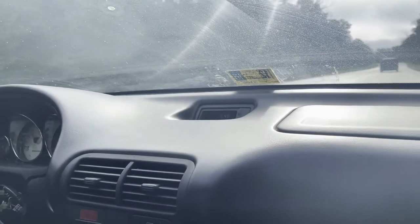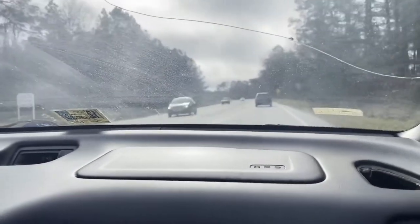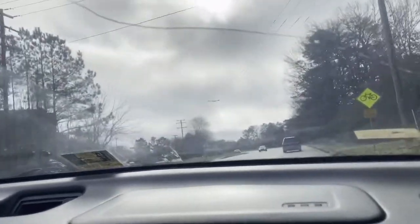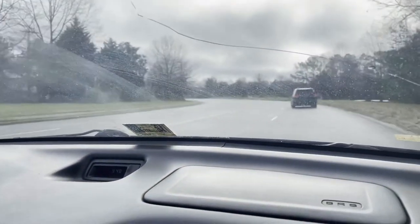She's good now. I need to adjust the clutch a little bit, so I'm going to adjust the clutch. Bring it out just a little bit because you got to push it to the floor. Put it in first gear. You shouldn't have to do that. But we bled the clutch. The clutch is bled right, so we're getting good fluid out of there, good squirt, and no air, so we're good on that. So, all right. Well, we'll see you at home, and figure out what else we can get done to the car today.